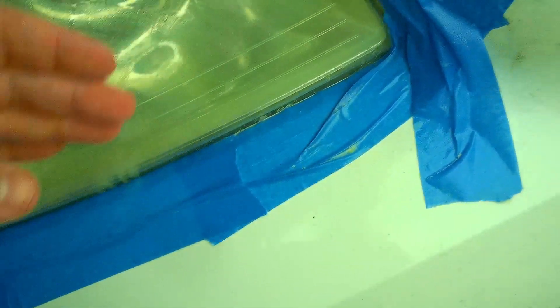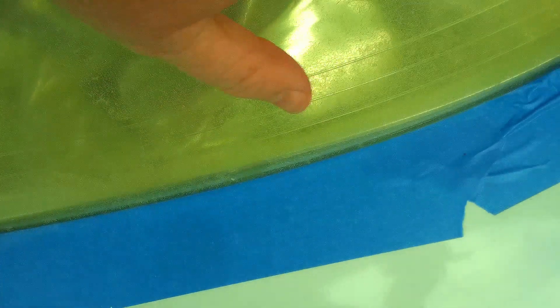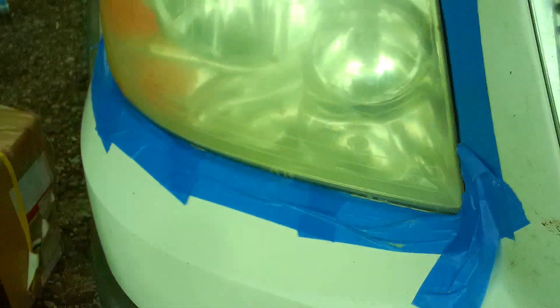Okay, already that's looking a lot clearer. You can still see some of the deeper cracks, but the lens itself is looking much better. I'm not sure if that's because the sandpaper did a deep cleaning of the cracks or smoothed them out, but it does feel a lot smoother. I'm going to continue with the other polishing wheels — the kit only had one of each, so I'm saving the other 800 grit for the other side. Starting with 1500 grit next.